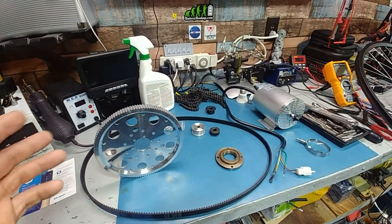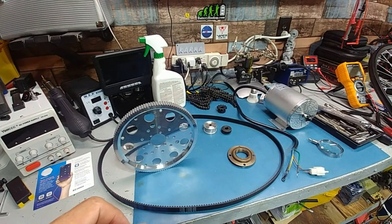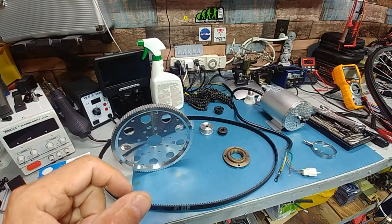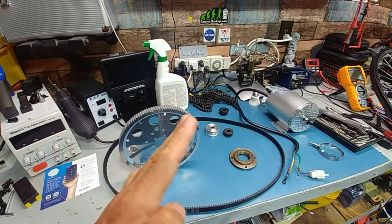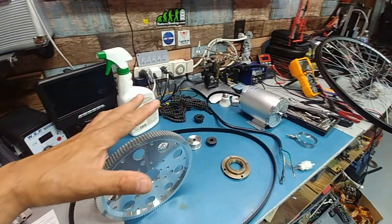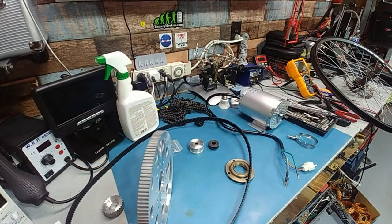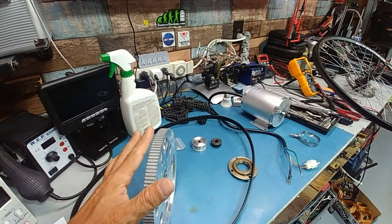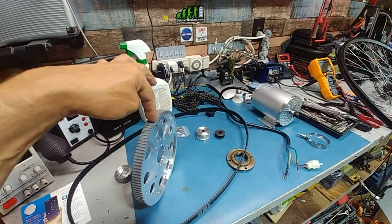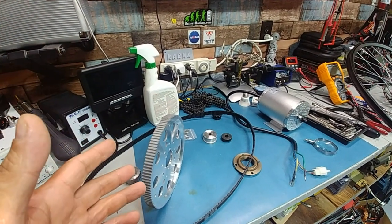This is probably better suited to a single-frame bicycle. I have a dual bike — basically a cargo bike that I extended with two frames, bolted and welded together. When I hit a mean pothole I can see the back of the bike actually flex, which is no good for this. The minute it flexes and isn't totally in line with the motor, the belt will just ride right off.